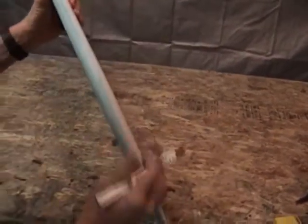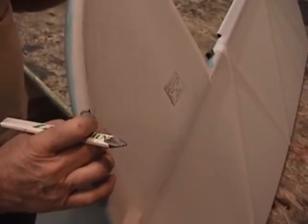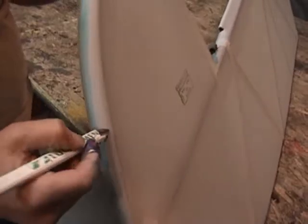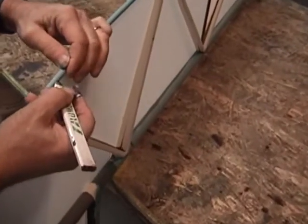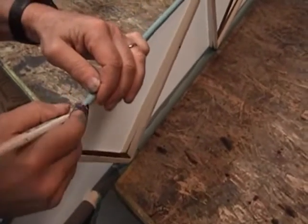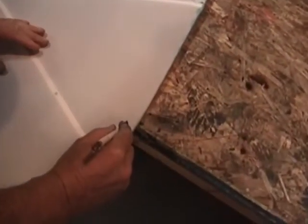What we're going to do is wrap the fabric around the tube. The STC requires a one-inch overlap. Very easy to get that around this tube right here — you can stop anywhere and you've got your one inch. Down here we've got a fairly small diameter tube, but if you check from this point, wrap it around, you're going to find the one-inch mark comes about right in here somewhere, which is pretty close.